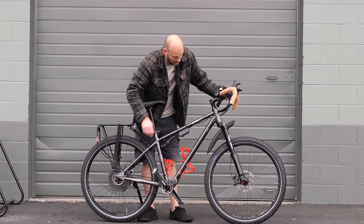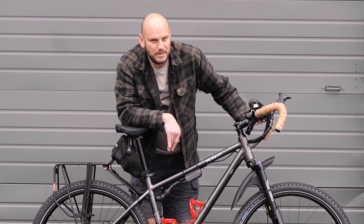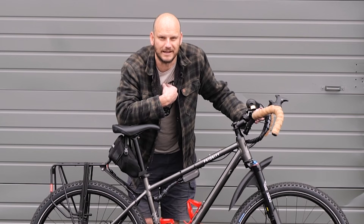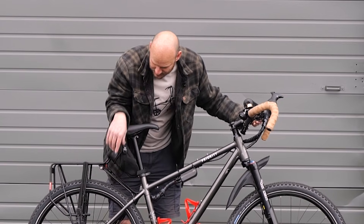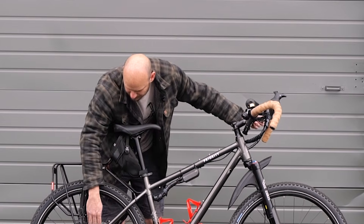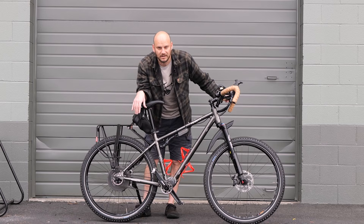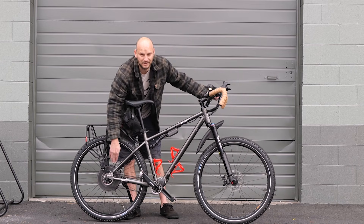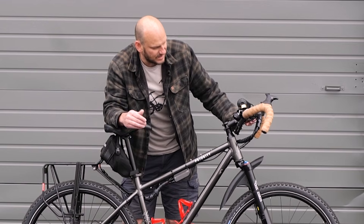This bike is one of the first bikes we've done where we added the Grin All-Axle hub motor. These are, in my opinion, the best hub motors you could be putting on. You guys know I like mid-drives, but if you don't want a mid-drive and don't want to worry about what gear you're in shifting, this is by far the best hub motor I've come across. It's a direct-drive motor, which means it can handle a lot of power without burning up. It doesn't have planetary gears, so no nylon gears to melt. These motor systems can handle a wide range of voltage — anywhere from 36 to 72 volts — so you can really dial in the exact performance you want.